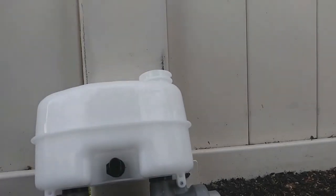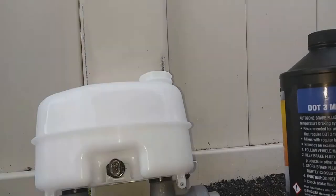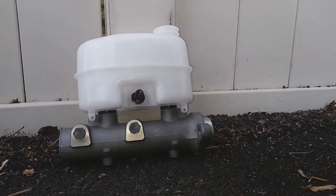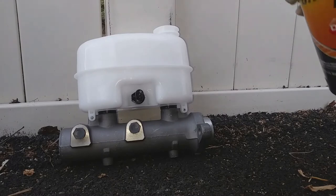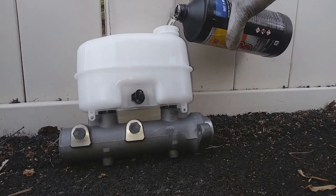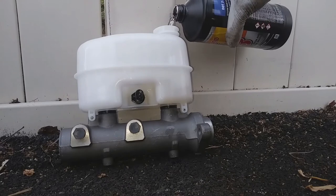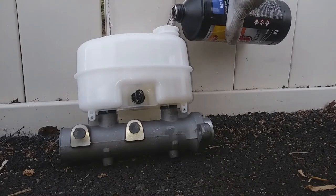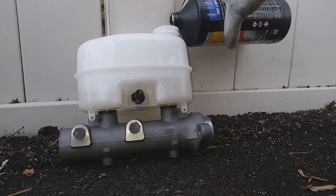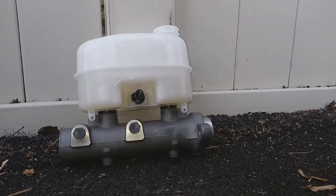Okay, so what you want to do, once you get these stoppers in there, is put brake fluid just below that line that you see, that middle line on the reservoir. You're not going to fill it, but you're going to put the brake fluid just below that line. You notice there is a hump in the middle of the reservoir, so you want to make sure the brake fluid clears that hump, till you've got brake fluid just above there. All right,